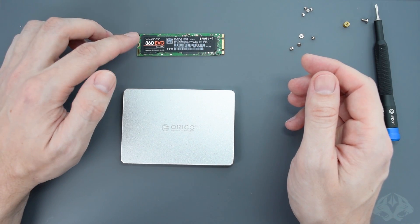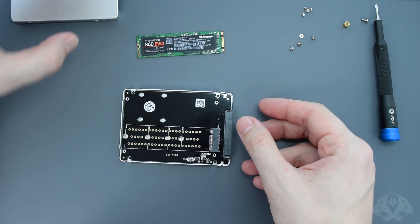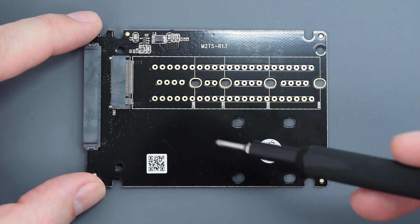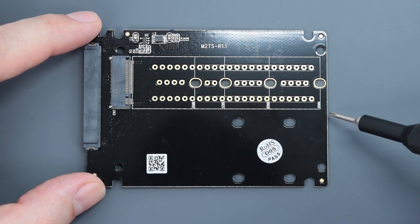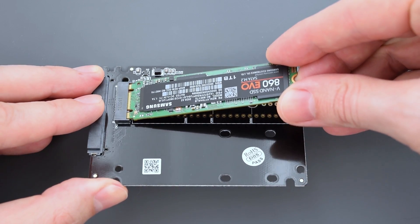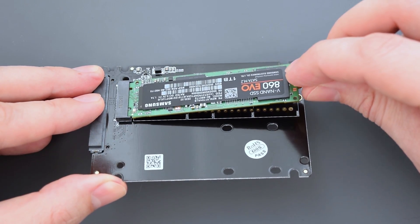So what I'm going to do next is put this 1TB SSD drive into this enclosure. This adapter allows you to connect M.2 SSDs which come in 4 different sizes. I'm going to use 22 by 80 millimeters, but you can use any size you've got available. Next insert your SSD drive at an angle into the slot, then attach this little brass piece and screw it down.